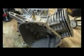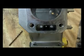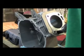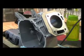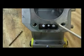Use a one-fourth by one-eighth hose barb and an eleven thirty-seconds drill bit to drill a hole in the crankcase and install a pulse fitting. Next, drill out this hole right here with a one-fourth drill bit to increase the oil flow to the balance shaft. As you can see after the hole has been drilled, it is a lot bigger.